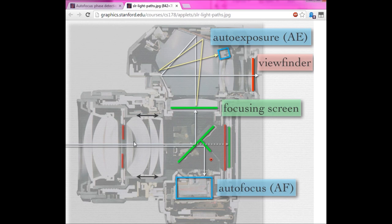And that gives them the major advantage that you can control your exposure fairly precisely because the flash stops very rapidly. That's not drawn on here, and it's kind of an unusual thing that's not used everywhere, but that's how the TTL metering works. And we will see the various features of that in the teardown as well.